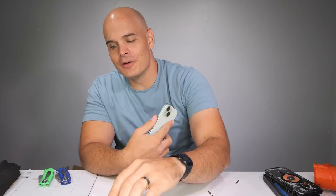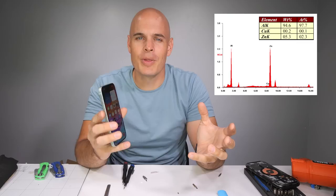This is the aluminum iPhone 15. We learned quite a lot about the titanium of the iPhone 15 Pro through some rather destructive analysis, but sometimes the non-destructive science can still be pretty interesting. I sanded off the exterior anodizing of the iPhone 15 and stuck it in a desktop XRF scanner machine so we could analyze the metal frame. We found an alloy of aluminum and zinc, meaning that Apple is once again using 7000 series aluminum for their base model of iPhone.